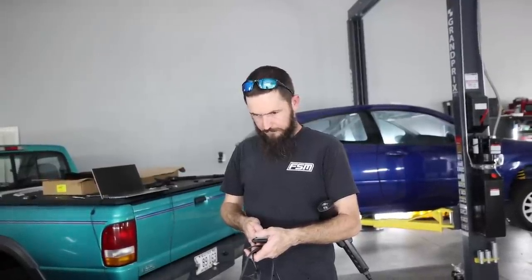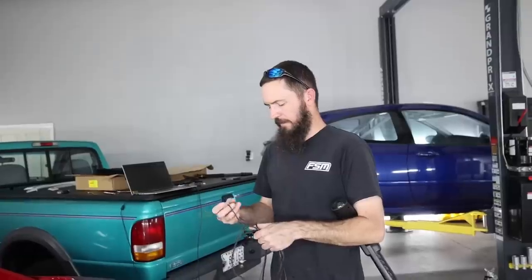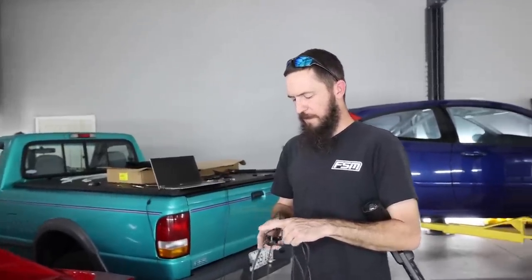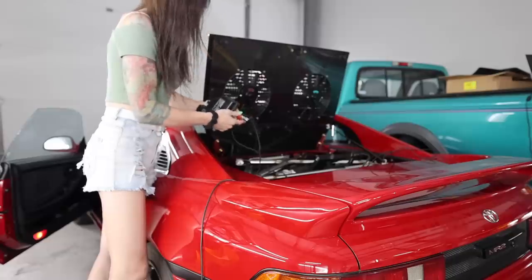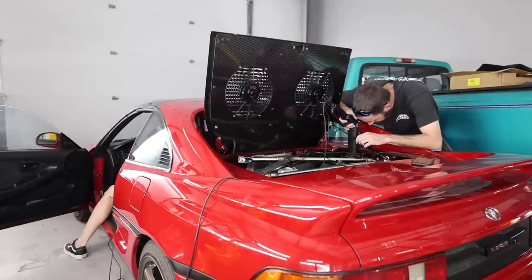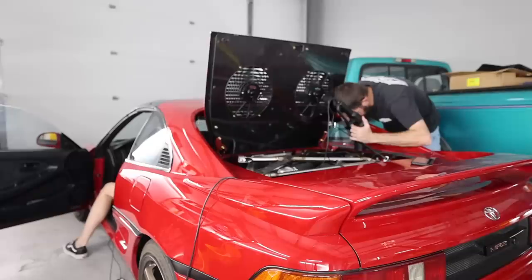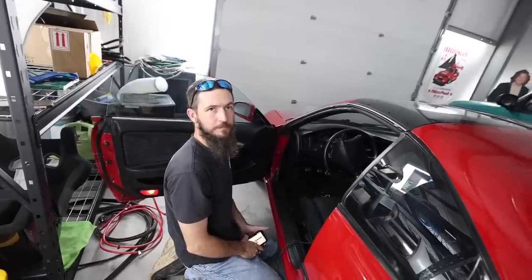It's not like Charlie was in the middle of doing something — I asked him to come over here and help me. It takes two people to do this. You can't hold the timing light back here, verify timing on the laptop, while simultaneously working the laptop and turning the ignition key. Alright, start it up again. So the issue was a little bit of a communication error when setting the reference timing. In the laptop it says 15 degrees for reference timing, so with the timing light we were setting it so we were seeing zero on the actual markings. It's a little bit confusing unless you know the system, and neither of us do — neither of us are tuners. So it was essentially 17 degrees off. That's why it ran like crap.